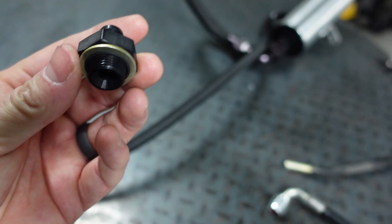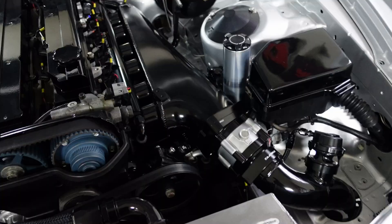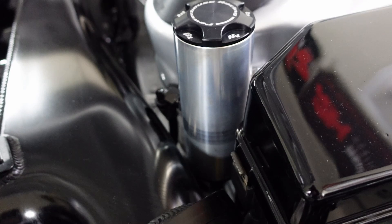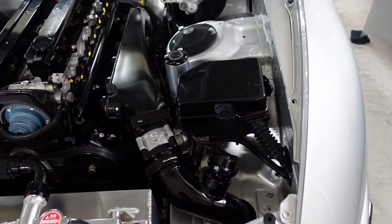I use a 120-degree fitting up here — you might ask why. With my wife's car, I can see I have it at 120 degrees because I actually have to bend it back — it was so close out here it was touching the manifold. When you straighten it out some it actually touches here, so this gives me a little more room. I'm able to angle it off to the side a little bit more. It seems dumb, but it does work. I also have to put a small hole to move it even closer and remove the bottom bracket. That's with my intake manifold, these MCC loyalty manifolds. The Greddy ones are even worse, but this does fit with the fuse box location — no drilling, no moving of the factory location even with drive-by-wire. So it does work well.